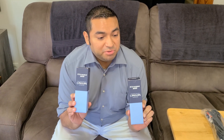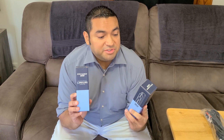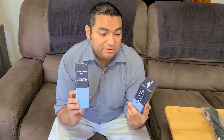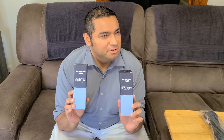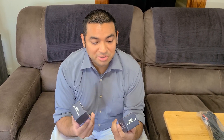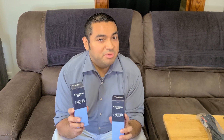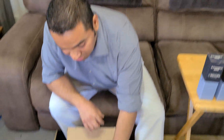Here's where we went a little extra. These are the Xenon Depot Xtreme HID rebased bulbs. From what I understand, it's a genuine Philips D2S capsule rebased to an H1 base. These are a little more pricey, but from what I saw online they provide the best light output for those Mini H1 8.0s. So I'm really excited to see how they compare to what I put in my CR-V.